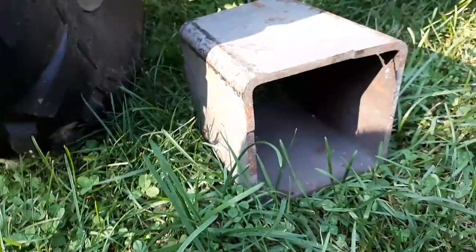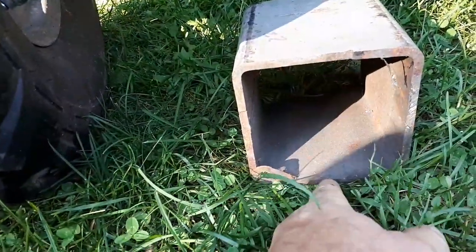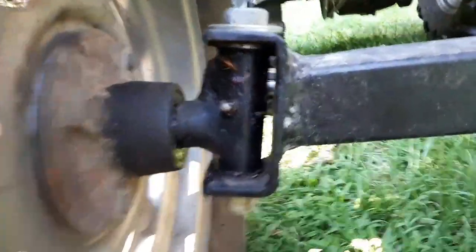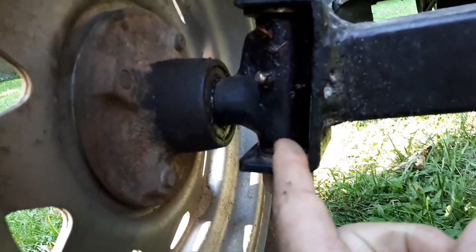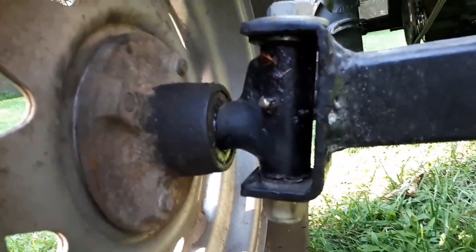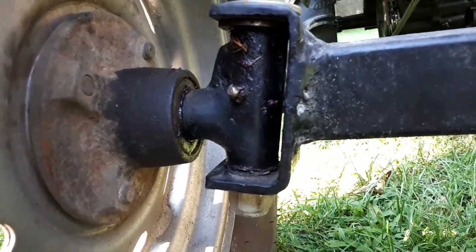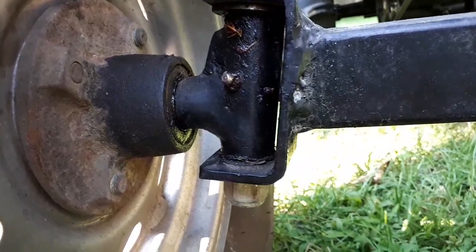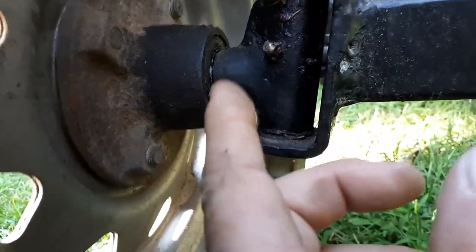That's what I used to make the ends — I cut a hunk of that a couple inches wide, cut it down the center, and that gave me my two actual ends. The rest of it is gas pipe and trailer parts. One-inch gas pipe was my main piece. I slipped them, squeezed them closed so they fit nice around one-inch bronze bushings.